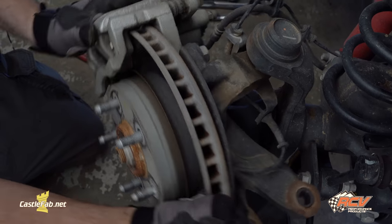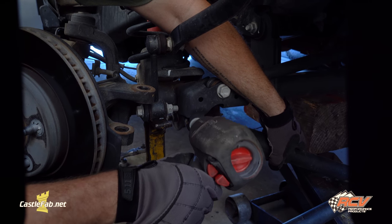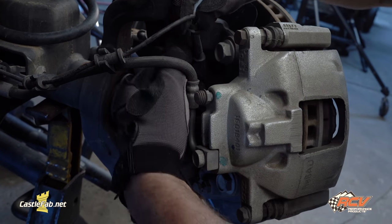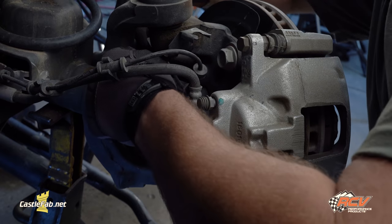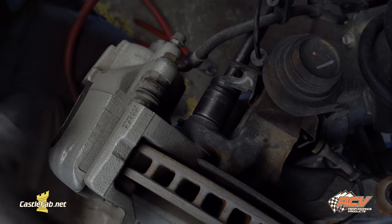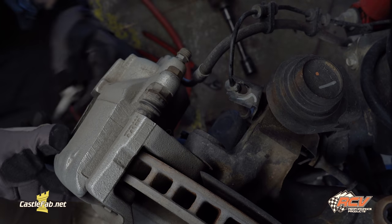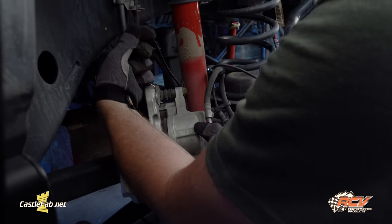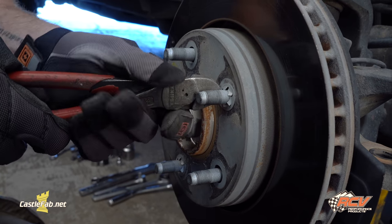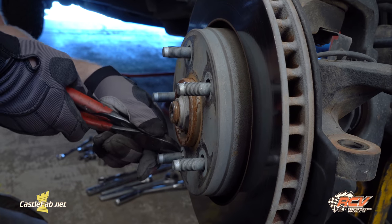Now that that's free, I can freely move the knuckle back and forth to access hardware on the backside. I'm going to go ahead and remove the steering stabilizer or dampener just to get it out of the way. We're going to remove the two bolts holding the caliper bracket on so that allows us to get the rotor off. As you're doing it, make sure you remove the ABS line and not damage it. Once the caliper is off, use a wire to hang it to take a load off of the brake line. A lot of times the factory rotors are held on with clips if they've never been replaced, so you've got to pull those clips off — it's not necessary to reuse them because the wheel will hold the rotor on once it's in position.